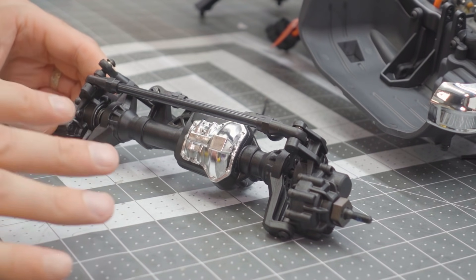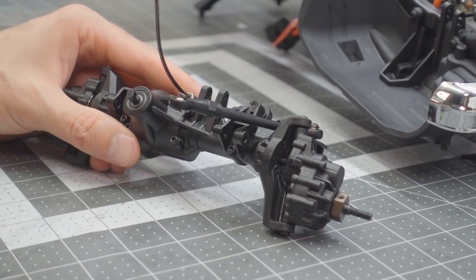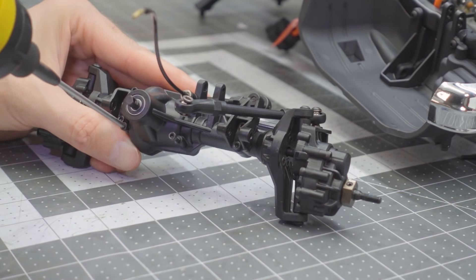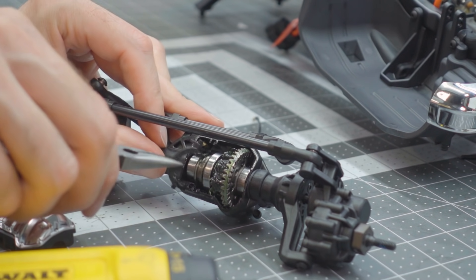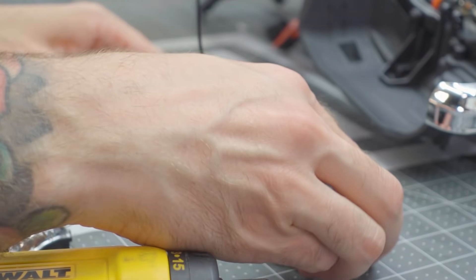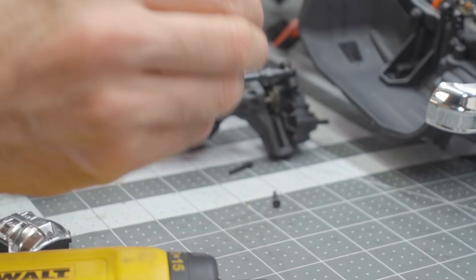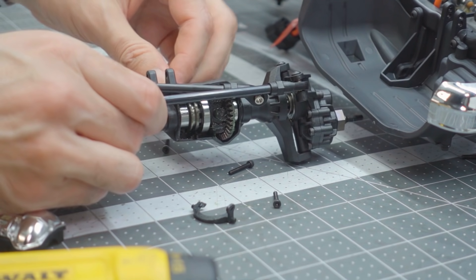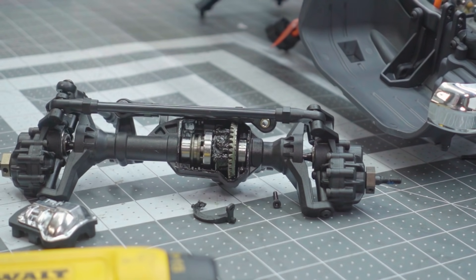Now that the axles are removed and all original links and shocks are off, it's time to adjust the shifting cables. We need to get into the actual axle — the best way is to start at the back and remove the front diff cover. We need to get at the shift lever here, so we pop that out. Flipping it to the other side, we remove an e-clip — everyone's favorite — and the locker mechanism comes right off. Now we can pull out the T-lock cable; it just pushes straight through from the back, and we replace it with one of the longer ones.